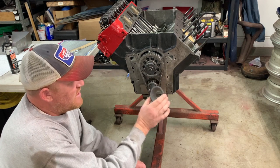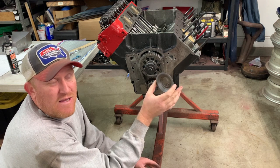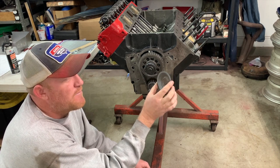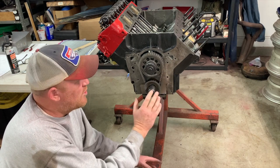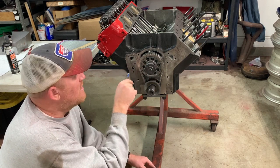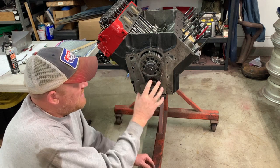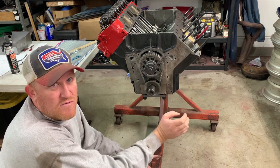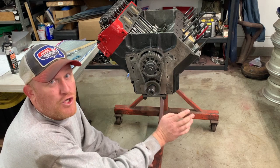These are normally stamped steel and they have a fairly smooth finish. I always take the time and blast these - you can rough it up with some sandpaper - but that gives it more teeth to grab more oil and sling a little better. It doesn't really impact the engine overall; what you're trying to do is sling as much oil as possible because that's how this entire assembly is lubricated. Some will put an oil feed line in their timing covers to spray the cam gear for the distributor, but roughing this up gives it a much better ability to sling oil without needing those internal modifications.